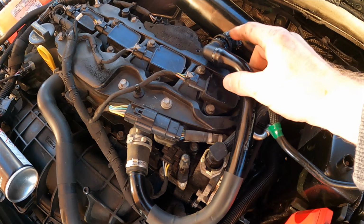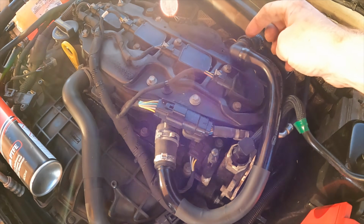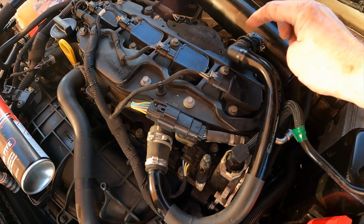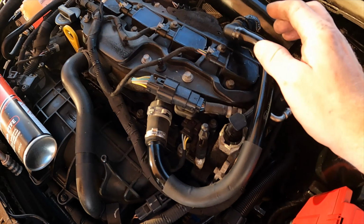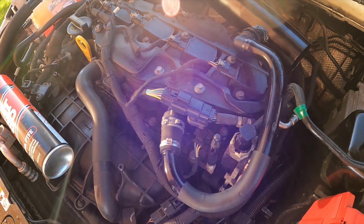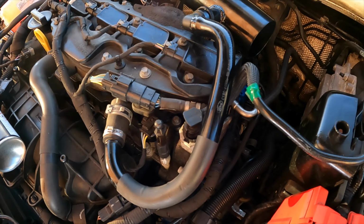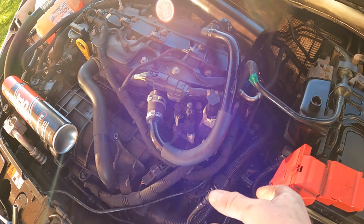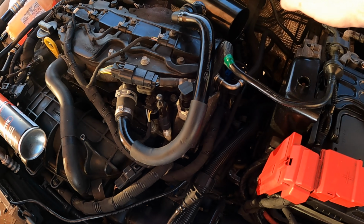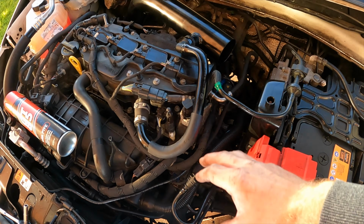Turns out that does fit back on. I guess it's designed to. I just basically GT85s or WD-40 around the rubber rings that are in there and also the inside of the pipe. I took it off there first and then just sort of wiggled it in and give it a bit of force and it's in. Ain't going nowhere. Right, so that's cool. So next up's the silicone pipe onto there, because that hose clip will be an arse with that panel back in, and then we can start putting all the top end back together and then we'll finish off down here.